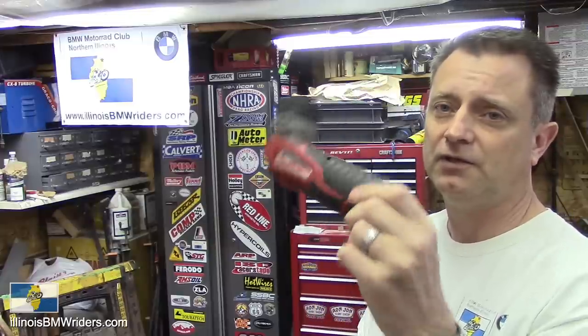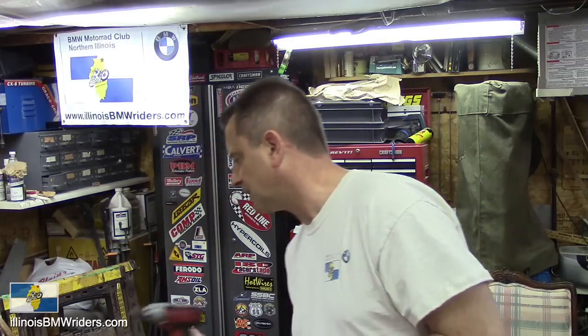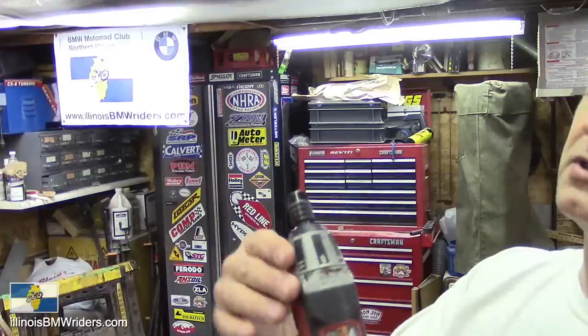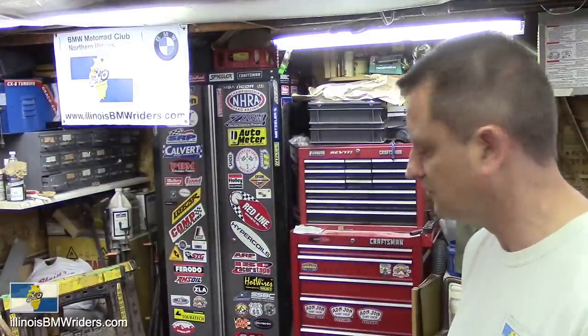Get the flashlight to go along with it, then you can utilize both batteries. The batteries charge up pretty quick. Everybody makes one of these — Hitachi, Bosch, Makita, you name it. An excellent little device to have. Even the cheap ones from Harbor Freight wouldn't be all that bad because there's not a lot of torque involved in taking off the screws. The setting I typically go with on this drill is number six on all the panel screws, sometimes seven. Inside your manual you'll find a crossover to foot-pounds or inch-pounds.